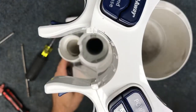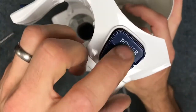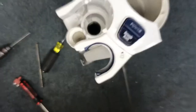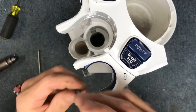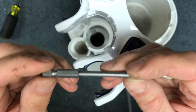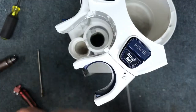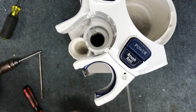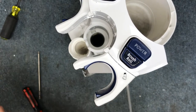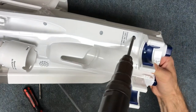To get access to your power switch, you're going to need one special tool. It's a security Torx — a T20 with a little hole in the center. That's Shark's way of telling you they don't want you getting into it. This model actually has a mix of Phillips and security Torx screws.